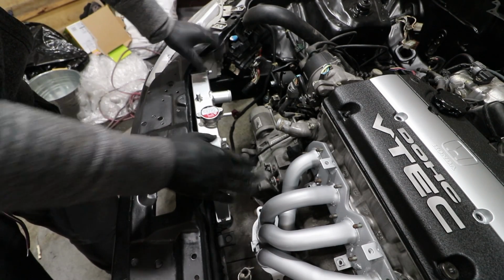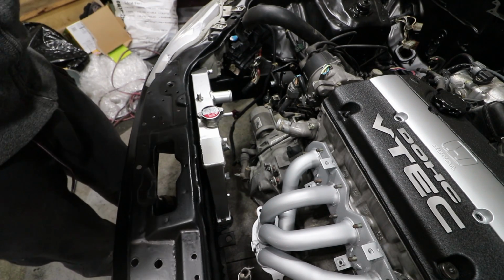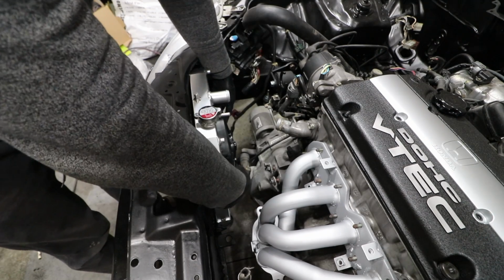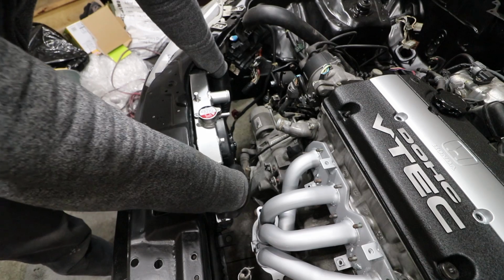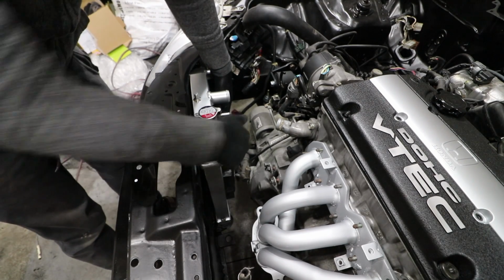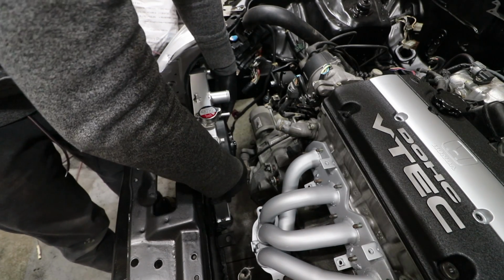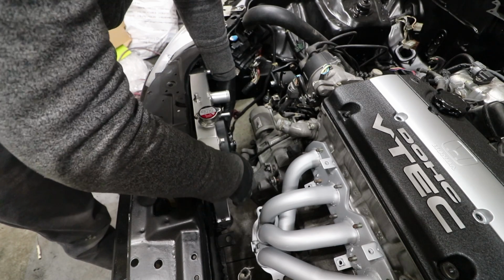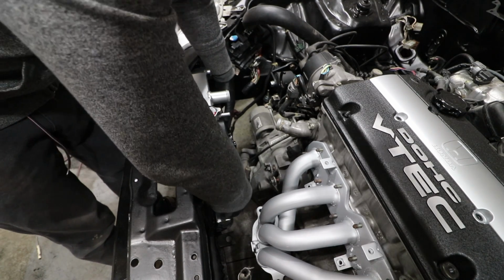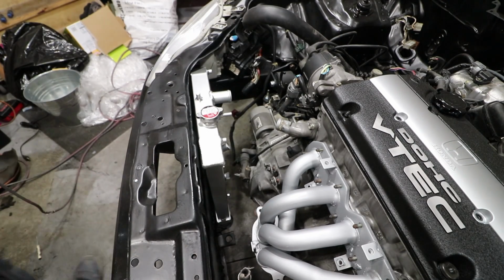Radiator is kind of just sitting there. Check out if the fan has clearance. I think it does. Oh yeah. So the fan has clearance. That slave cylinder just touches the back end of the fan but doesn't impede the fins inside. So what I'm going to do is actually just put this in here, kind of line it up with a marker, because I'm going to put these zip ties that mount on it, because there isn't going to be a shroud or anything on that.